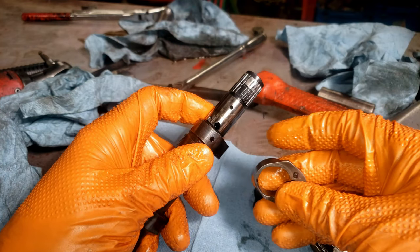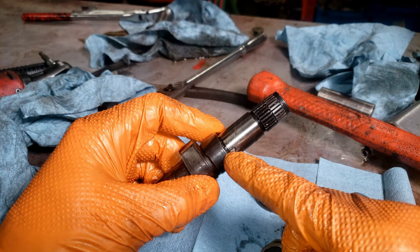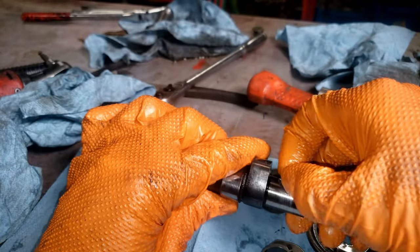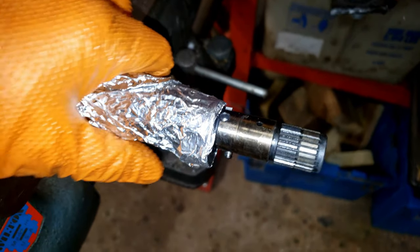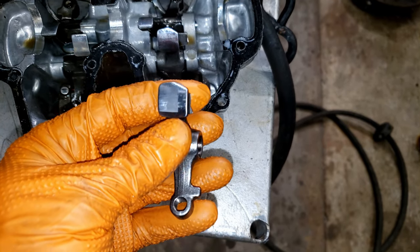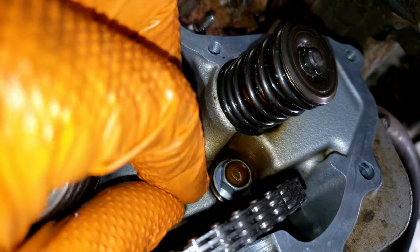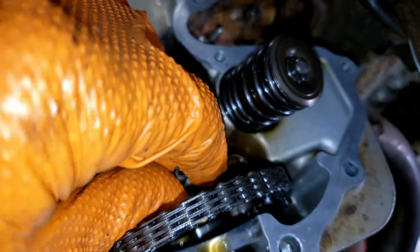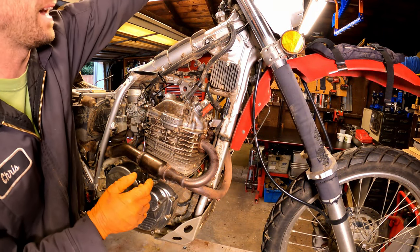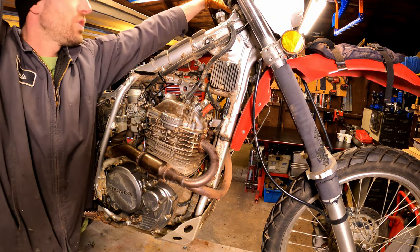This is the next day. I've removed the mechanism. You want to weld both of those oil holes shut so pressure doesn't bleed off, tack-weld that pin, and tack-weld that pin too, so they don't go flying out when the engine's running. I'll put some light grease on the lobes in case of any splatter, put some tinfoil on it, and that's ready to tack. I'm also throwing his original rocker back in since it's mated to the camshaft. If you're getting rid of the decompression, don't forget to take the little spring pin out of here too — you wouldn't want that floating around in your engine. It should have a little spring on the bottom as well.